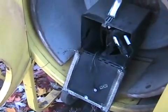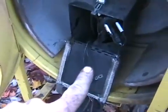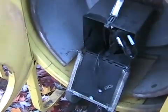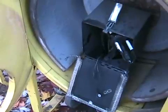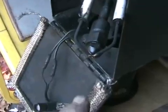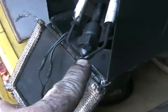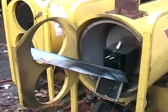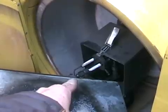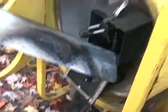So if I want to fire this thing up, I turn it on. Nothing will happen, of course, because it's sensing light. Then I put my finger on it, give it the dark signal so it thinks the door is closed. Then as soon as I remove my finger, it gets the light signal and thinks it's time to ignite it, and then it'll start working. The light it gets when I remove my finger — if it was actually in the box — is the light that comes from that little spark. For demonstration purposes, the fiery injector is pointing out the wrong way from this unit, and I've got a heat deflector on there so that the heat won't melt my photosensor. So let's go do it.